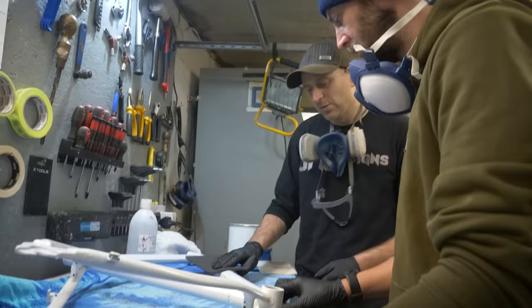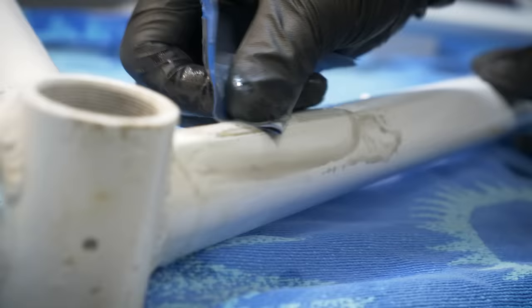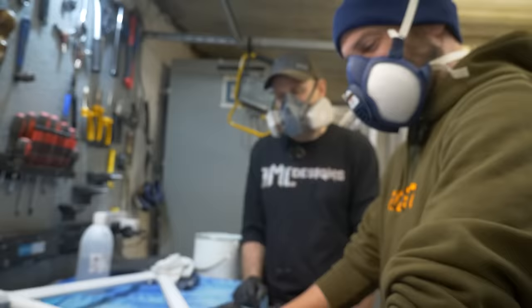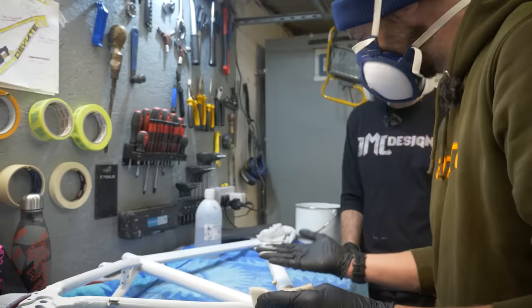With the scotch pad, it's just a case of rubbing it down, smoothing everything out — you want to give it a good old bit of elbow grease. You can see where it's bumpy it starts to flatten that out a bit as well, and that will give you enough for the paint to bite to. Shall we get the mask on? I'm going to start on the chainstays with our 500 grit flexible sandpaper — we're masked up and it's just giving it a good rub down. Any lumps and bumps, any chips — try and sand them out smooth. I can see why you've definitely got to wear some kind of mask for sure.